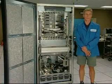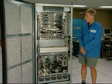This is the SV2 air-cooled chassis, which rejects all the heat generated within the cabinet to the surrounding air. In the air-cooled cabinet we put in four node modules. If we have more than one cabinet in the system, we'll add two router modules at the top to communicate between the two chassis.